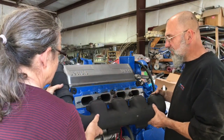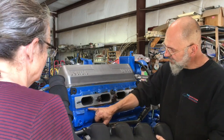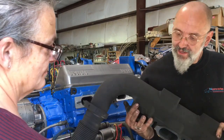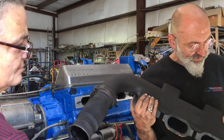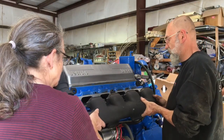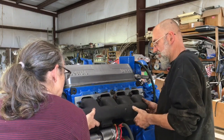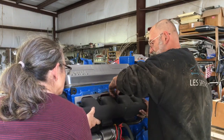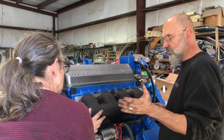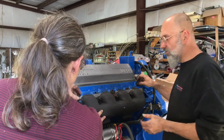So with the help of my lovely wife, the exhaust manifold — as you can see, there's these bumps here. These bumps serve a purpose. They're to register against these bumps here to make sure that your exhaust manifold is perfectly aligned. It slides up. Now it's resting on those bumps and we don't have to do anything else. It holds itself there.